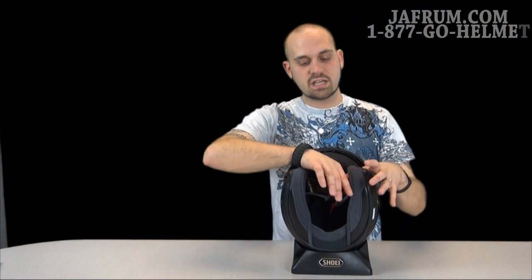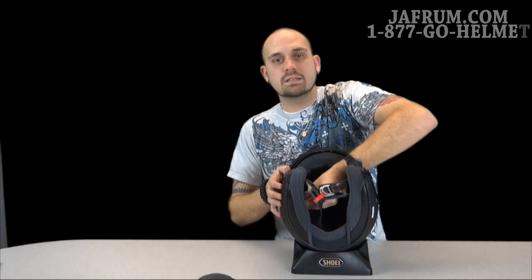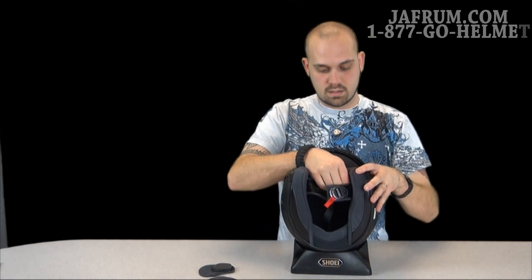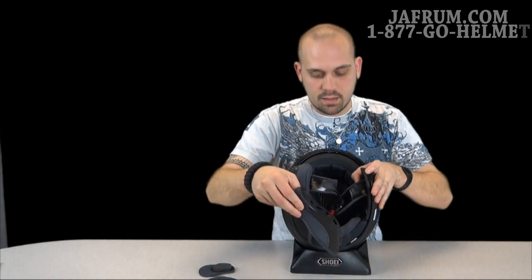You'll notice here the cheek and ear pad are built together with a little opening in the back. They actually have removable inserts around the ear padding — all Shoei helmets have that insert. What that does is allow you to pop it out and put your Chatterbox or whatever kind of communication equipment, whether it be your Bluetooth headset, into that spot if need be. Those are very easy to remove. Now here at the cheek pad, it's got one snap with another snap right behind that, and then a snap here in the bottom. You just pull your loop out, slide it out from the bottom, and your cheek pad is removed. Very simple and very easy to do.